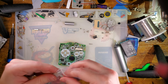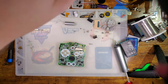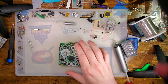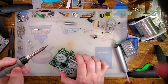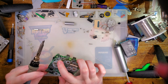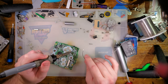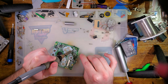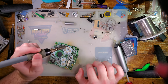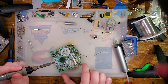So like I said, this is a regular Game Boy Advance version, not the SP version. I know Funnyplaying intends to make a version specific to the SP, which means how I get this connected is gonna be different than the SP version, but I'm gonna wire this up. Tin, what is that, TP9, and then over here I've got,